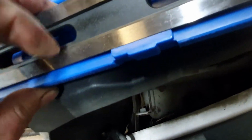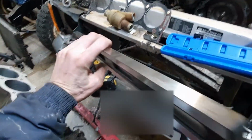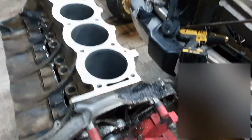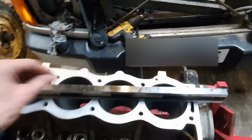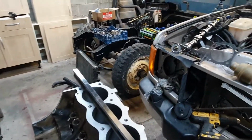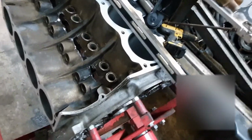It was enough money. And the next most expensive was 800 in this sort of section. I wanted it nice and big like that so I could comfortably just lay it flat on the side so I didn't have to hold it, because what you find with a steel ruler is you're holding it, and in doing so you're introducing an error. You can bend it. So that can just sit on the deck like that now, nice and easy. And I can use the smallest feeler gauge I have, which is 0.05mm, or 2 thou, I believe. That's the one there. Let me fold these others away.